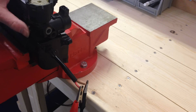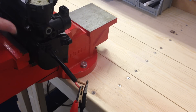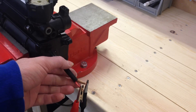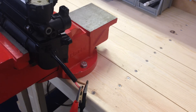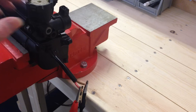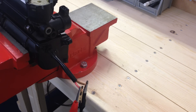After carrying out this repair, it's worthwhile testing the compressor on the bench to make sure it's running correctly and that the output has improved. To do this, there are two wires coming from the compressor — a brown and a red-and-white. Connect the red and white wire to the positive terminal of a 12V car battery and the brown wire to the negative terminal. This will allow the compressor to run continuously so you can check the output.